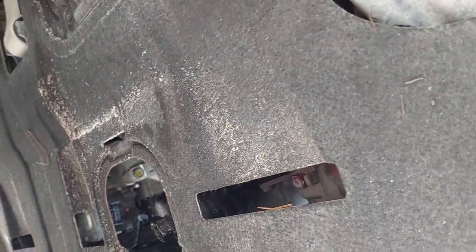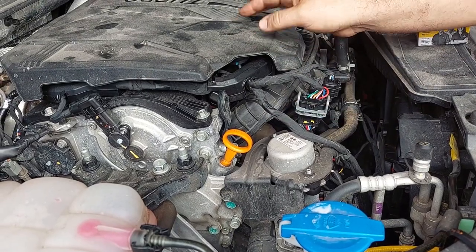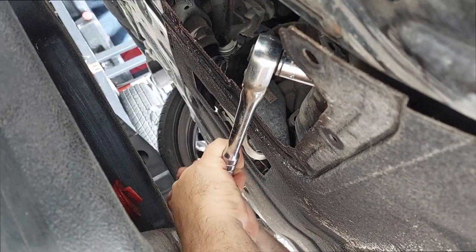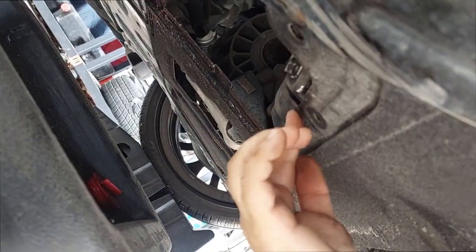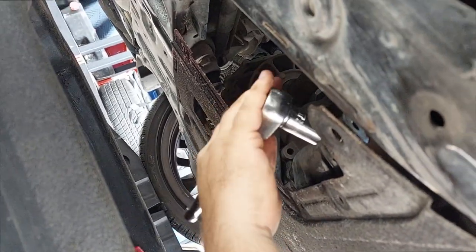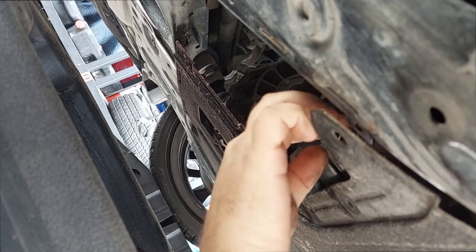Something to avoid — you should always do this anyway, but on this engine it really matters because this crankcase is sealed up good, it's turbo. Pull the oil cap so when you open your drain plug it has somewhere to let air in, otherwise it glug-glugs like when you dump a soda bottle out. This drain bolt is 17mm. And because you're going to get a shiny new crush washer, don't try to murder this thing when you put it back on — the crush washer does the sealing for you. Otherwise the poor guy that comes behind you is going to really curse the guy that did it before.